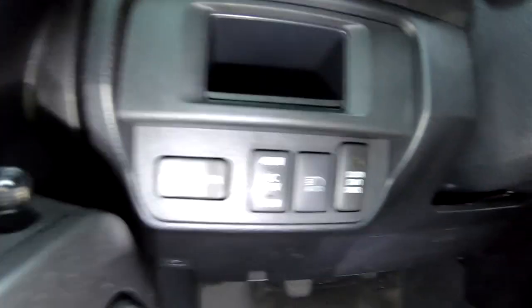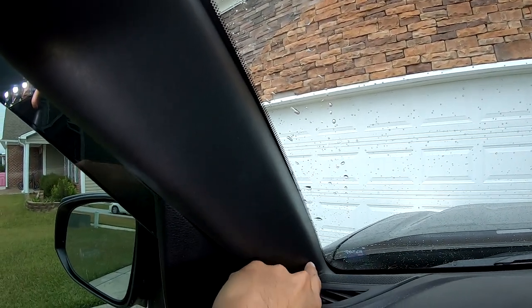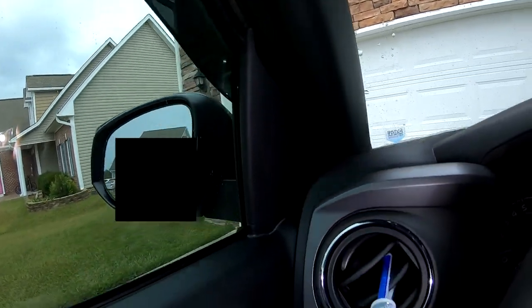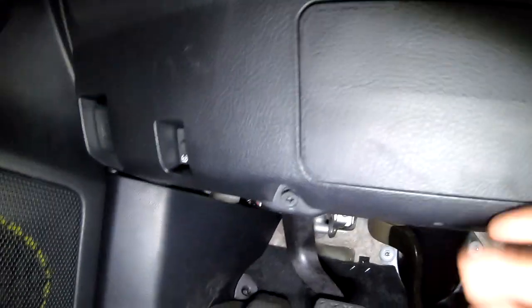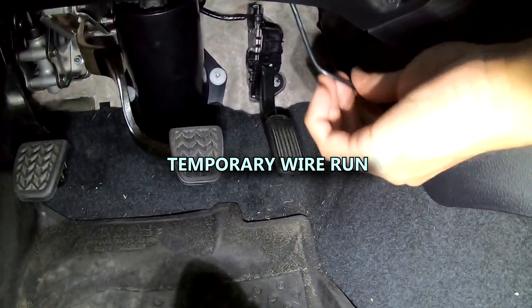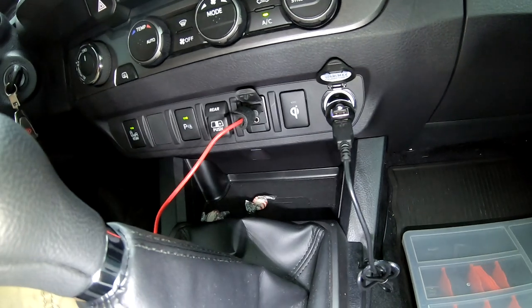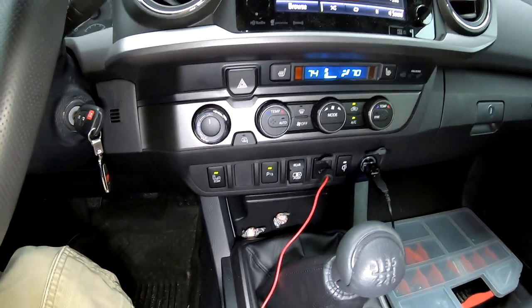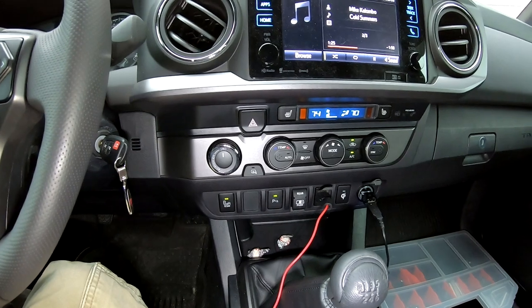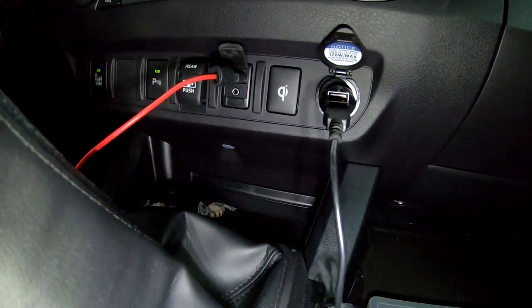So now I don't have everything wired up exactly how I want it yet. I was running the wire down here underneath the A-pillar garnish, running down to the side behind the dash, going across — from this side all the way to the other side and plugged in here right now. I'm going to try to wire it into the fuse block that I'm putting together for the amp rack. Next video I'll get started on that amp rack and hopefully get some power to that system pretty soon.